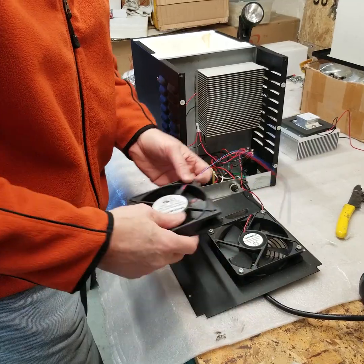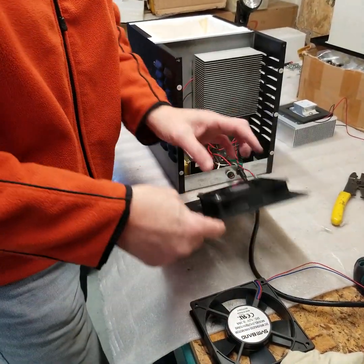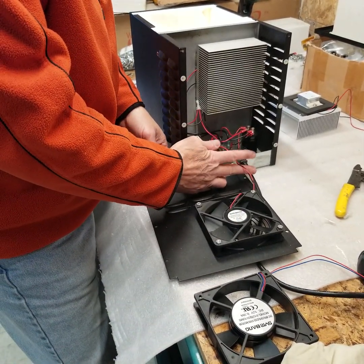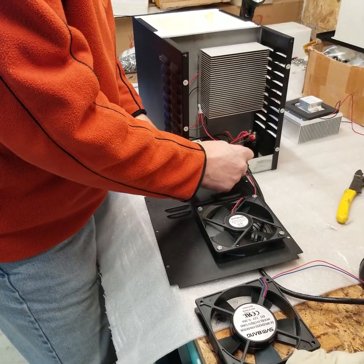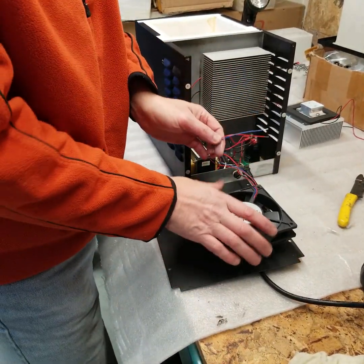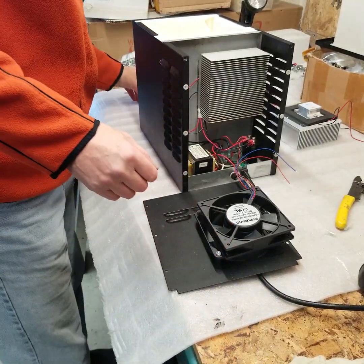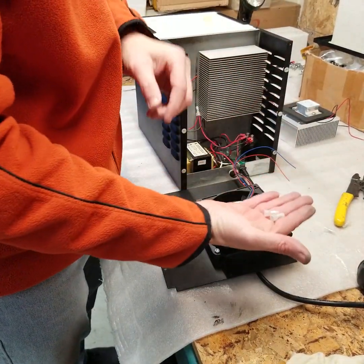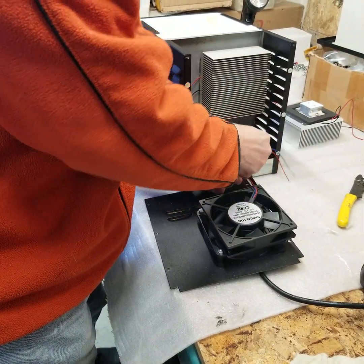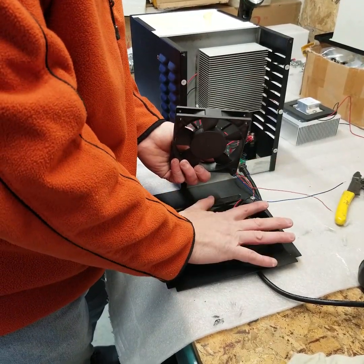To replace the fan, there are four screws with nuts — remove the nuts and screws. Cut the wire halfway again from the capacitor, strip the insulation off, and apply the new wires with the corresponding colors. You will be supplied two crimping nuts which you can use to crimp the wires. Re-apply the screws.